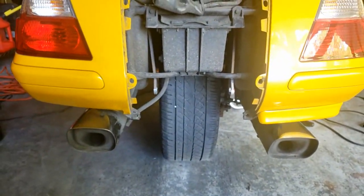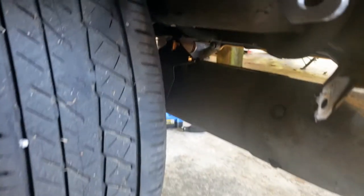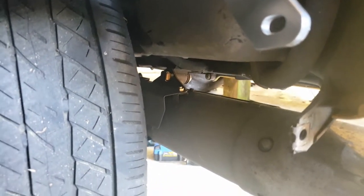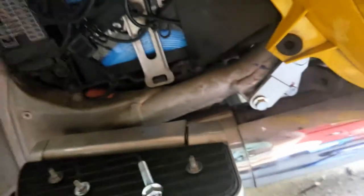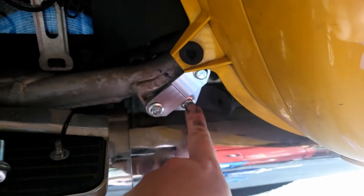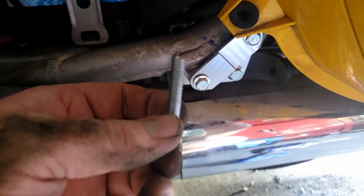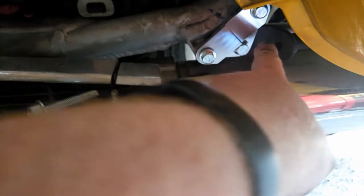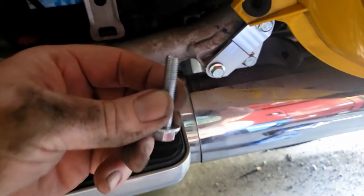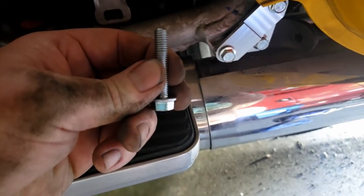Now I have both of those in — there's a nice bracing, and underneath you can see the shiny nut. You take off the little acorn nut and put that in there, which creates clearance to install the main hitch. On the left side, the bolt on this bracket is the longer one — there are two in pouch number one and one is longer, so pay attention to that. The longer one goes through the receiver hitch with a nut on the other side. Shorter one on the right side, longer one on the left side.